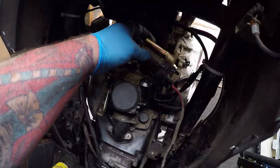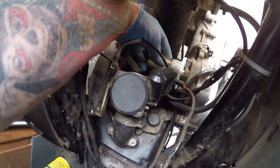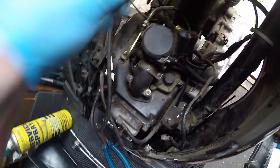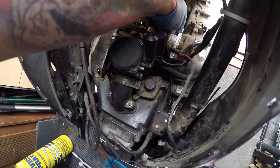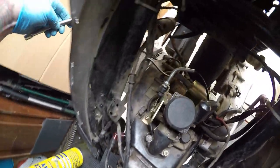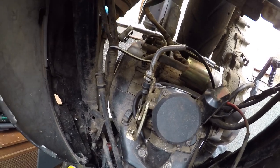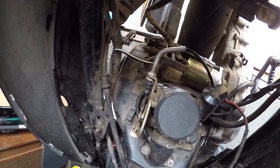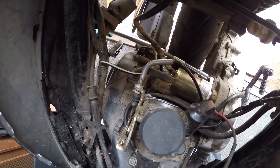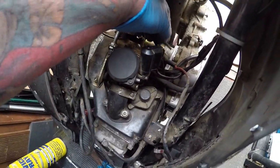There's your starter, wire simply connected. Look how easy that is — it just fits in like that. Then you put that wire back in there. It's got two bolts. One bolt in there, tighten it up. It's so much nicer to come in from this side and get straight in there. A few connections makes it a bit wiggly but it does turn nicely. Do not do one side up before the other — just do that one, then pop this one in under there, and then tighten that one up. Plug it back in and we'll see what happens.